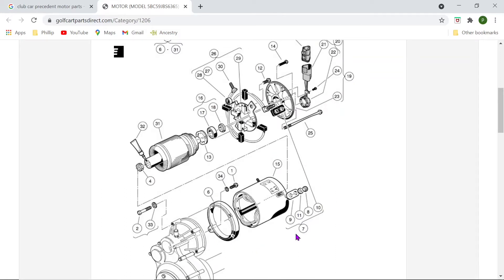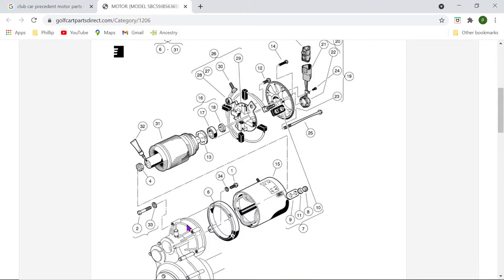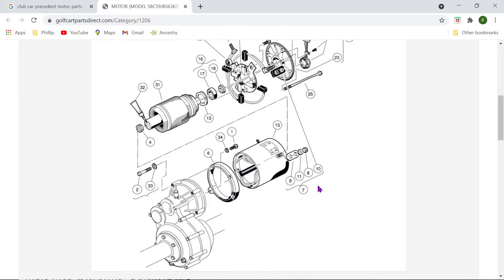Well, I worked and worked on mine. I pried it, I did everything in the world and it would not come off. So finally I got a small gap in between the two parts, got a pry bar in there and started trying to force it out. Finally it started to move. I put a bigger pry bar on there and finally it started to break loose and come out. And that's when I realized the armature — the part that rotates — was still stuck. The spline was stuck in the transaxle. My only alternative was to beat it off, except there's no way to beat it off. You can't open this up and access the end to drive it off. The only thing would be to take the full assembly apart.